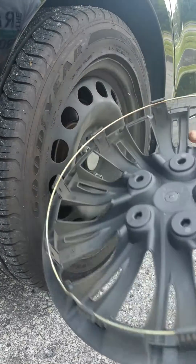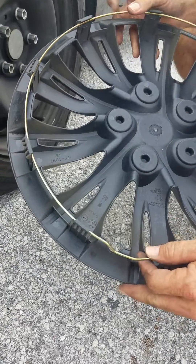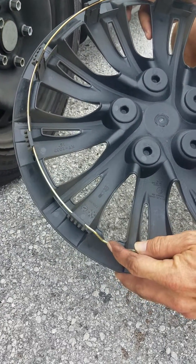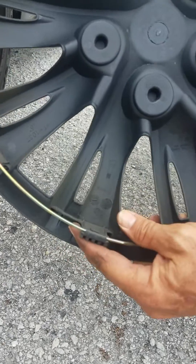Pull it off and look at your ring that you installed — probably wrong. Make sure the loop is pointed down toward the valve stem. Some people say up, but point it down.